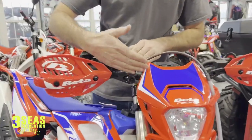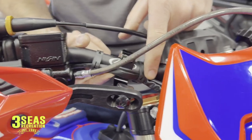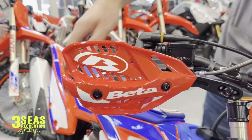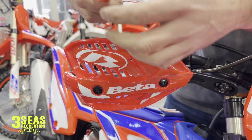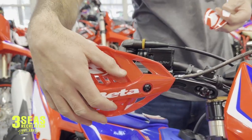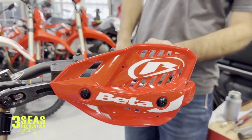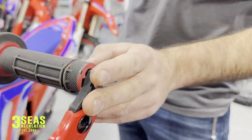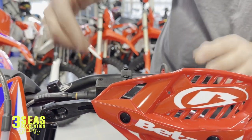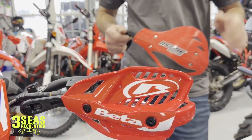Now the eye is completely done, we made our bend, and it fits way better. You can see everything lines up tight on the handlebar — we got our taper right on the mount, rubber straps holding our wires. I like to run the wires over the top so they're not below catching a stick — it's all tucked in nice. We got the plastic on the front. Beta gives you these two cool little fill-ins — it's 19 degrees here in New York today so we could fill that in to keep our hands warmer. We went ahead and did the clutch side as well — that side is super straightforward, just cut the grip on the end. I don't run the left-hand control block in my handlebar so there are no wires to worry about, but if you do have wires, run them above the mount like you did on the other side.